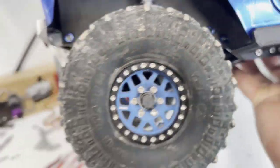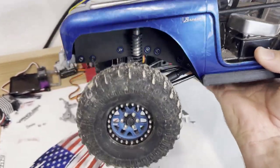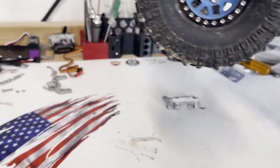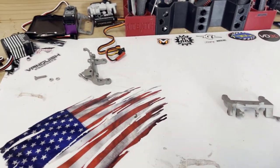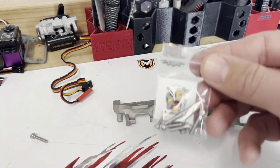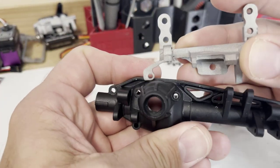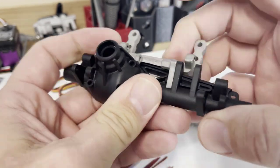I went with the tall boy on my Bronco build because I was being lazy and didn't want to do custom links for the low life, but a couple of team drivers and plenty of other people have done the low life without any major complaints. So let me grab a straight axle and show you how to do it. You'll basically get the same hardware kit whether you order the low life or the tall boy — you get a whole bunch of screws because there are a bunch of options. The design secures on the back of the pumpkin and also on the factory link mount.